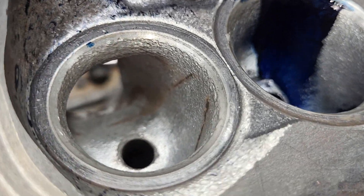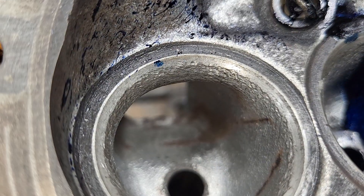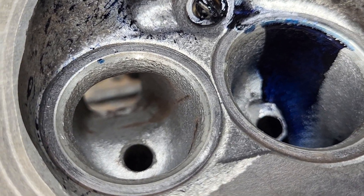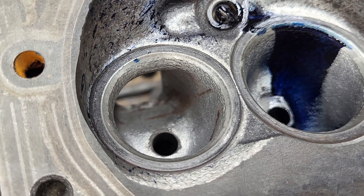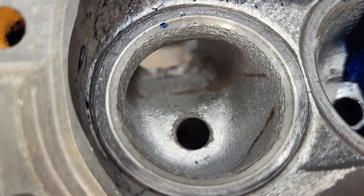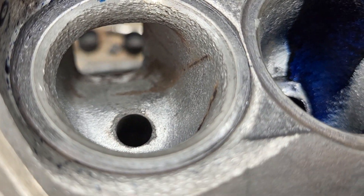The exhaust — you can see I didn't go nuts. It's got no texture at all. I did have to put a valve job on it; the guides were so bad it was almost impossible — horrible. But it's close; I was amazed it really didn't leak bad on the bench at all — in fact it was quite good. You can see I didn't even take all of the lapping paste ooze lines out.